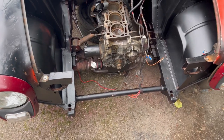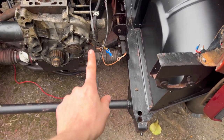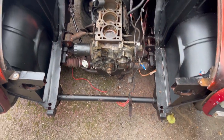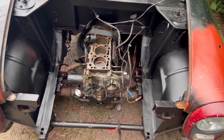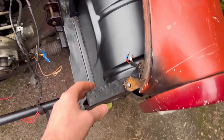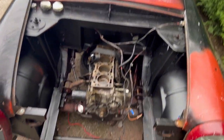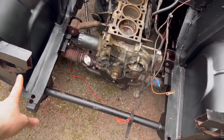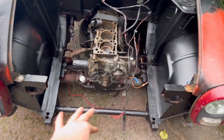On most normal 100Es there's actually a panel that comes right out almost to here on both sides, and the radiator brackets mount to it. Obviously this is all missing because it's had a massive intercooler in here and probably a much bigger radiator. It means all of this is very flexy, which means when you put the bonnet on it flops around everywhere. I've got a piece in the boot to reinforce it, but it's still not going to be that strong, so I'm thinking I might have to make something that goes back down to where it came from originally.